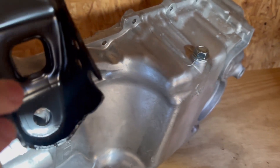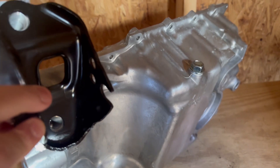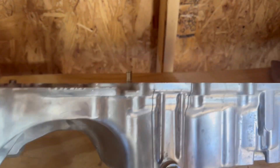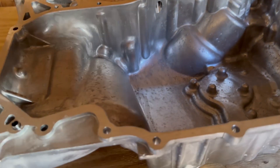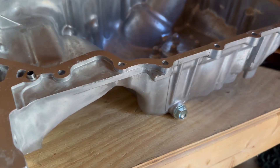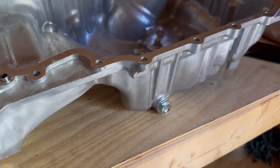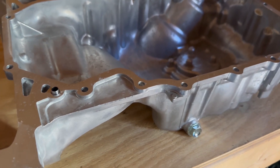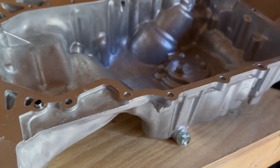This mount is going to go right in here. This will adapt your 10th gen rear mount or your 11th gen rear mount, which you don't need to order if you already have a Hasport or run the other brands, but you do need the side mounts. This will basically allow you to run the 11th gen or 10th gen rear mount with the K20 C4 swap.